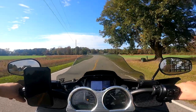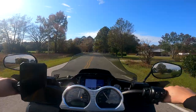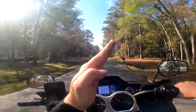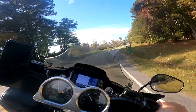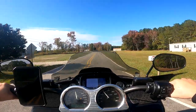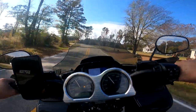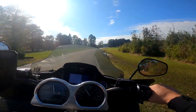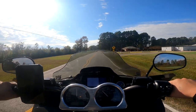I came back and made a few small adjustments once I got back to the house. I got an adjustable front motor mount, because the stock motor mount's fixed, and it'll twist the geometry of the back tire a little bit to the left or the right, instead of keeping them perfectly straight. These Harleys, especially the baggers, are rubber mounted, and the front motor mount does all the alignment, because the motor connects to the transmission, and the transmission is where the swing arm connects. It's just held onto the frame by some rubber blocks and two bolts. So most of your alignment for the rear wheel is coming off of your front motor mount.